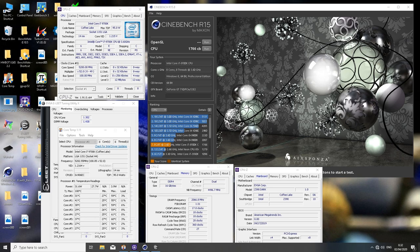So the lowest vCore I managed to pass on the Dark was 1.30 set, and that is 1.298 measured under load when you use the minus 25% small droop option. So the minus 25% is really spot on. It's nearly 100% spot on with the set value under load.